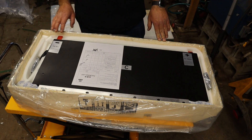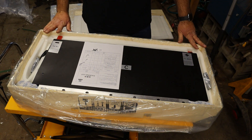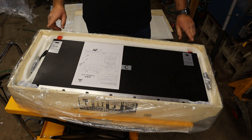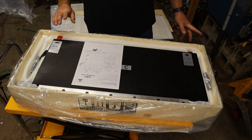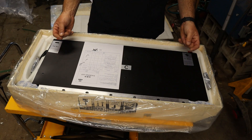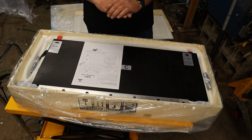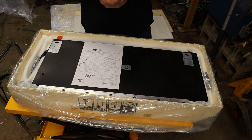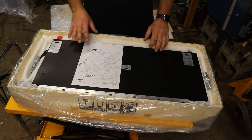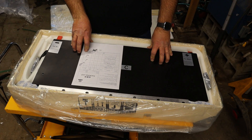I did my best to maintain the cover on here. Now, 87.2 volts — that's not going to kill me; I've been popped with 110 before. But anything above 35–40 volts will break the insulation of your skin, so I do have electrical safety gloves that I will be wearing during this install. Safety first. I want to document all the voltages on each one of these modules.